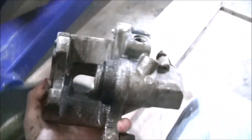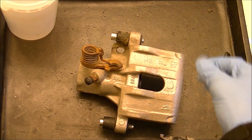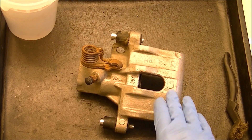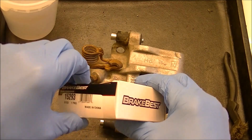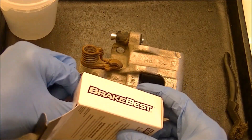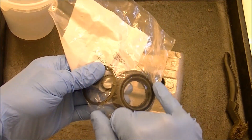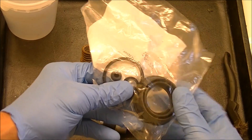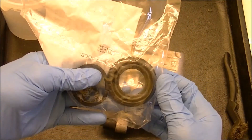And there's our caliper. I'm just going to let it drip into my drain pan. So I'm in the bathroom right now — not actually using the bathroom, I'm just in the bathroom with this caliper off of the Mazda 3 and I wanted to take a look and see why it failed. Now if this is in satisfactory condition, most rebuild their calipers. This is the kit that I have for this caliper, and what we mean by rebuilding them is we reseal them — new outer seal, new internal square cut seal.